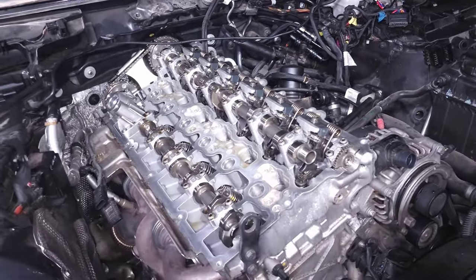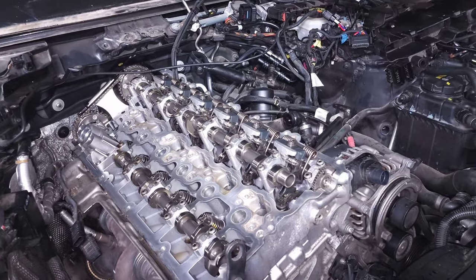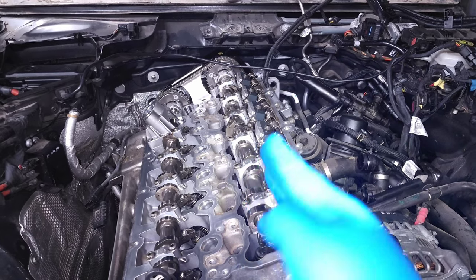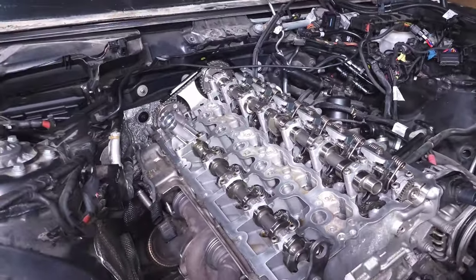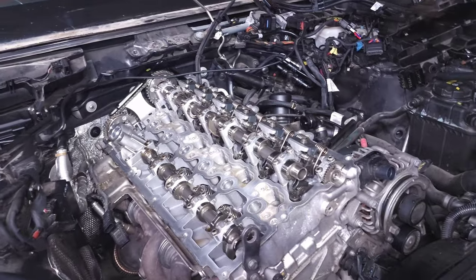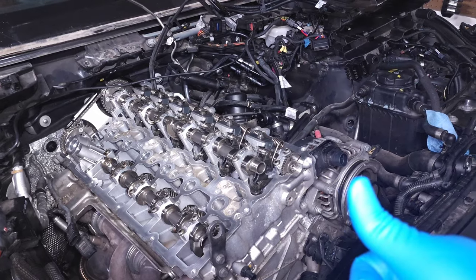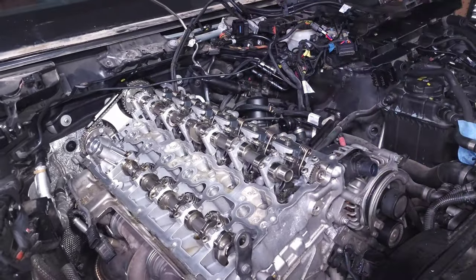It's very similar to how ignition timing works — you're measuring how far before top dead center your spark plug fires. In this case you're looking at the cam and determining whether it's going to retard or advance a little bit and control that rotation against everything else. In a lot of older engines you had multiple electronic units separately controlling oil flow to the camshafts, but now with everything in one compact unit you have that electronic actuator and a mechanical central valve inside the cam.